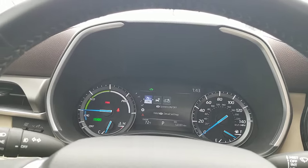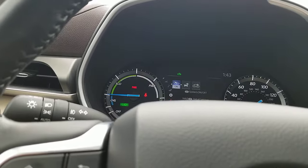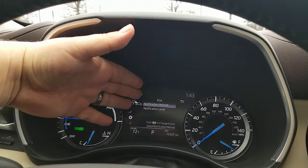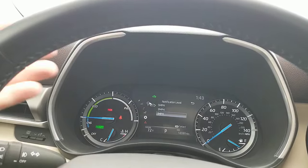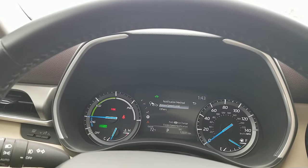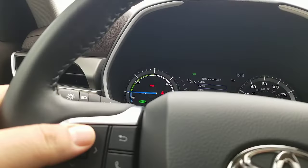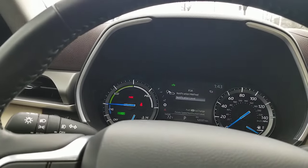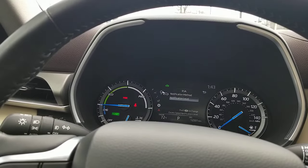You might not know what this is, but this is your road sign detection — you can turn that system on or off by hitting the OK button. But most people just think that's the only on/off option. If you look down it says 'hold OK for detailed settings.' So I'm going to hold this OK button for about two to three seconds, and now you see road sign assist with 'notification method' and 'notification level.' Notification level lets you set how many miles per hour over the speed limit before you're alerted — one, three, or five miles per hour over.